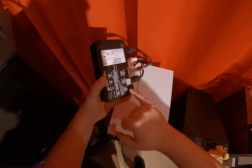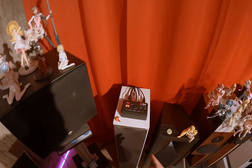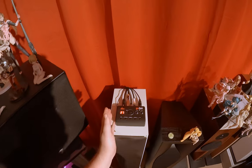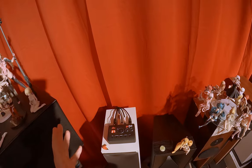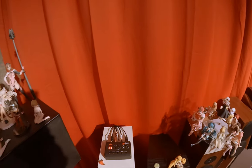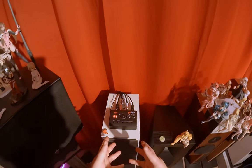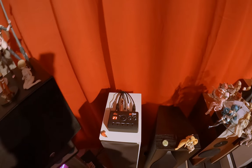In this scenario, you can go into the menu — there's a whole bunch of stuff written on the bottom explaining how to change different setups — and I put this in mono. Being a completely digital unit, it takes whatever analog signal you've got and digitizes it, because the subsynth and compressor work in the digital realm. There will be some signal degradation going from analog to digital and back, but we're only talking about a subwoofer and very little latency since it's all built into a single unit.